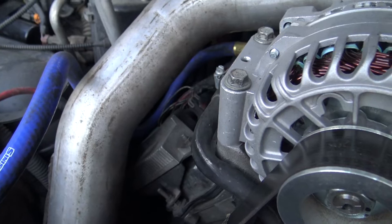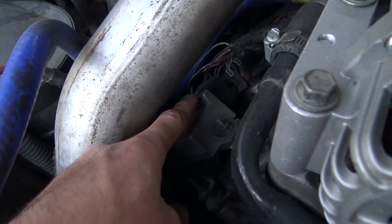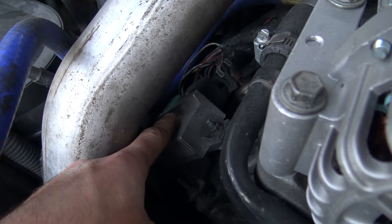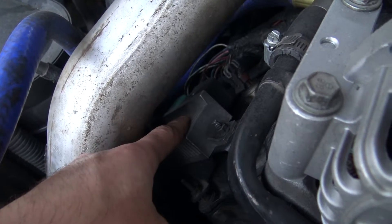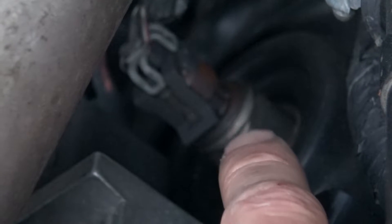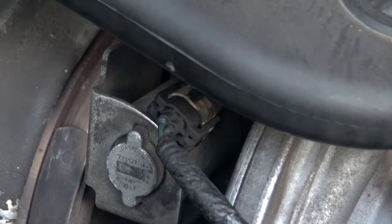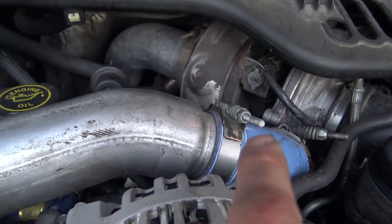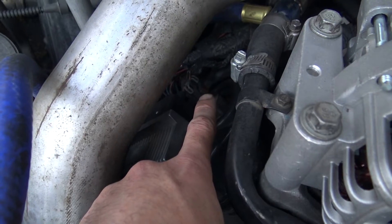Back around to the passenger side valve cover — there's a big thing on here with a black plug and a green plug. I'm not sure if it's a glow plug relay or a module, but it has something to do with your glow plugs. So keep that if you want operational glow plugs. On the passenger valve cover is your ICP sensor — injection control pressure sensor. If you have an 05 to 07 truck, it's right there. If you have a 03 to 04, it's back behind the turbo with your IPR, the injection pressure regulator valve. The ICP sensor is way easier to replace on the 05 to 07 if it has any sort of issue.